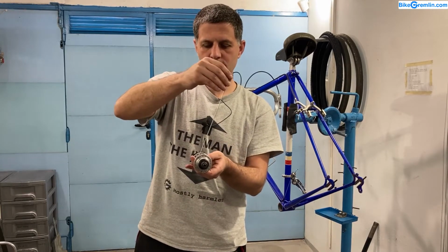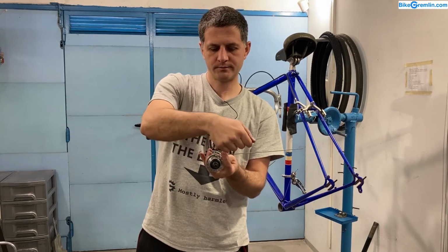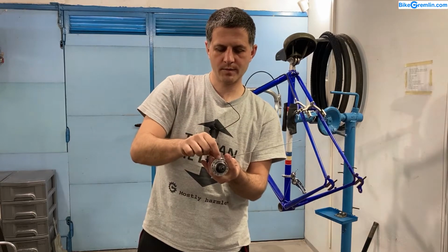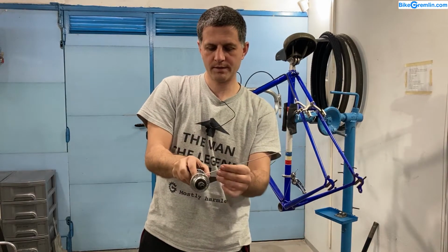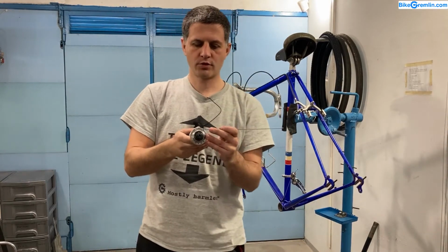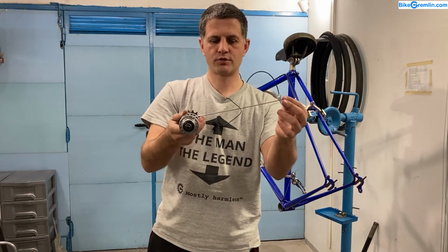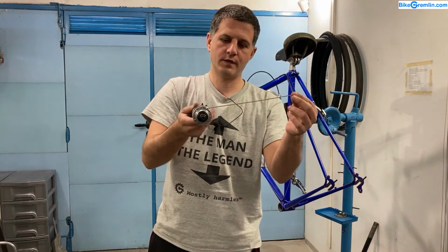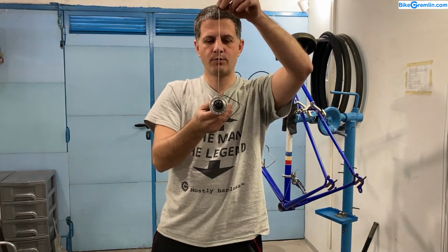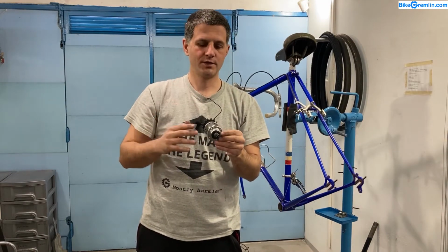This is like 1 across, 2 across, 3 across, and when you come 4 across, it's almost a 90-degree angle. So there's the highest amount of hub flange that the spoke can lean against. Same happens to the other side spokes. And this provides good strong leverage, and when it needs to resist any driving torque, the torque is trying to elongate it, which makes it very strong and stable, unlike radial lace spokes where the torque tries to twist the spokes, and it can twist them, but this way it's a lot more difficult, and the spoke has a lot easier job.